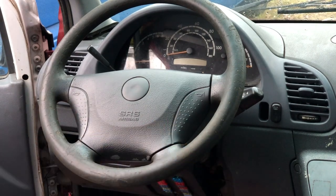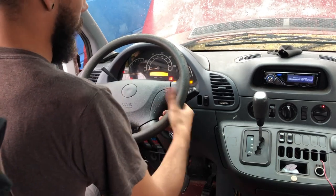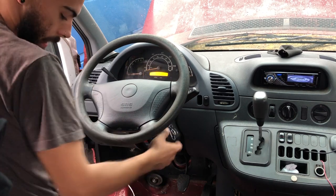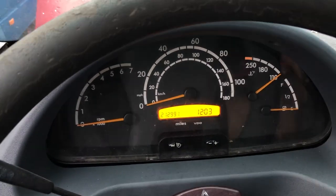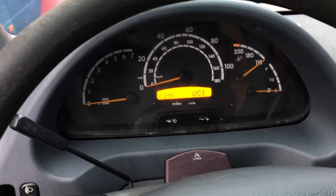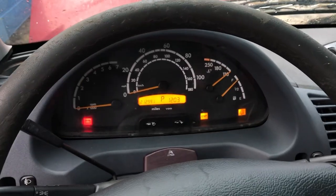We're almost at the point where I need to reconnect the battery and clear some SRS codes. The first immediate test of knowing if this worked is whether I get a horn — and I do have a horn now, that's good news. After starting the van I did still have an SRS light on, but with the AP200 scanner I was able to clear it — it was just a residual code. After clearing it, the SRS light now goes off after a short self-test. Excellent, and I have a horn again.